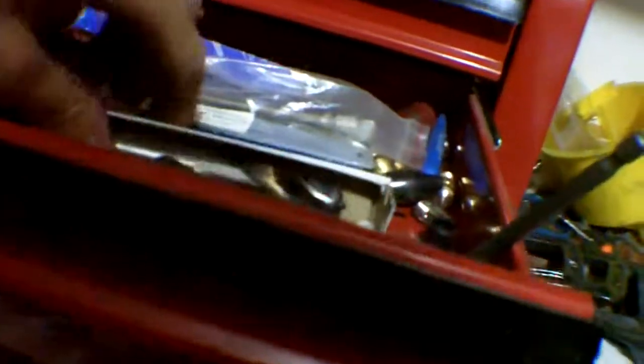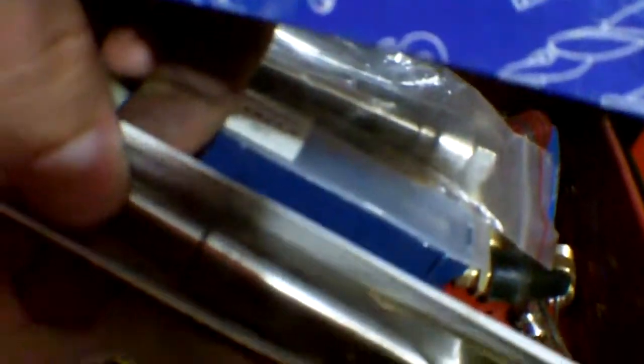It was extremely difficult to drill that out, and it was extremely difficult to spin a tap of that size. Obviously you gotta tap it by hand, but I ordered this drill bit, which is a metric 16.5 off eBay. I drilled that bad boy out and tapped it. The factory O2 sensor fits perfect.